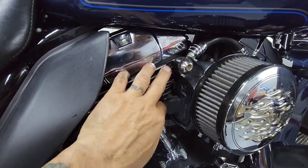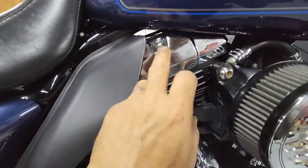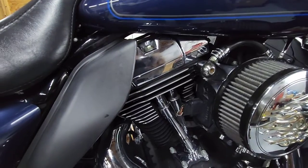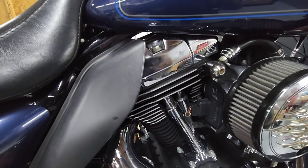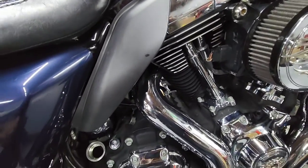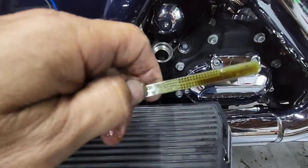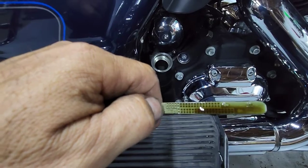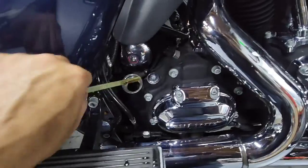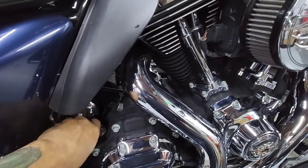Most of the time you'd see it here — it gets all over your engine and into your exhaust. So the little umbrella and sponge up there need to be serviced; they need to be changed every so many thousand miles — it's supposed to be in the manual. We also recommend that when you do an oil change or fill up your oil, never fill it up to the top. Leave about three-eighths to a quarter of a quart low, and that gives you extra room in your oil pan for extra crankcase pressure.